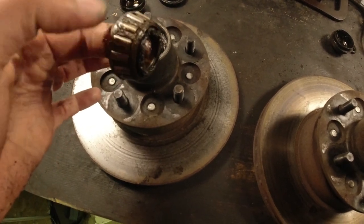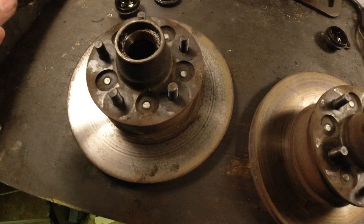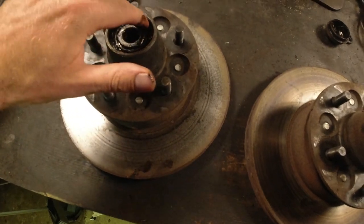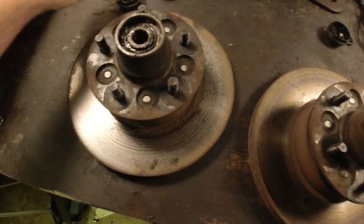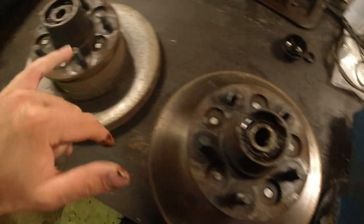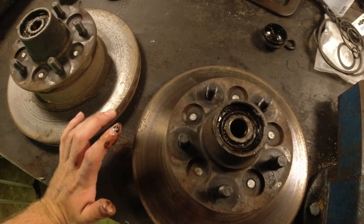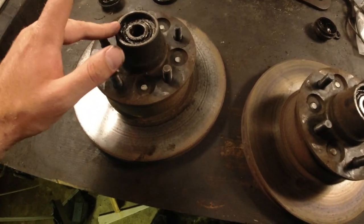I haven't cleaned it up yet - I'm going to clean it up properly, get all the grease out and check. They do look fine and were very quiet with no play - well adjusted. But the grease is just really old and there's not much of it. I like a lot of grease, and this isn't much. Doesn't smell burnt or anything, but there should definitely be more in the cap as well. The other side is exactly the same, though it has a newer style bearing with a newer style seal in the back.